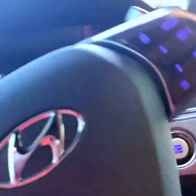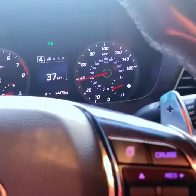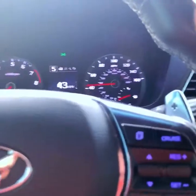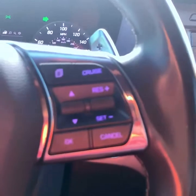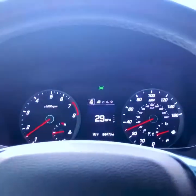When you're going to pass someone, most of your power is going to be higher up in the power band. So if I'm in fourth gear at 2,000 RPM, I'm not in my power band. If I drop a gear, it shoots up and puts me in my power range - that's the whole point of downshifting: to regain power and put you in your power band. It also helps with engine braking. Everything works together. But for an everyday driver on the street, you don't need to fully understand all the technical details to use it effectively.